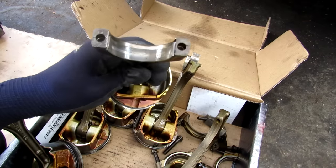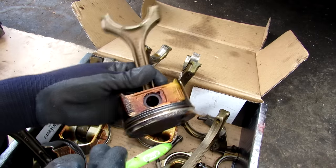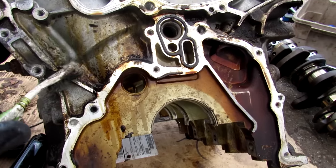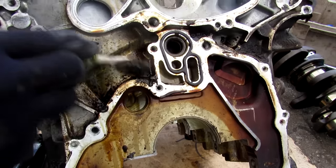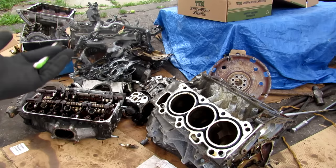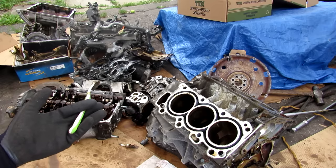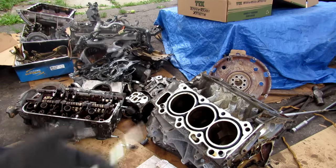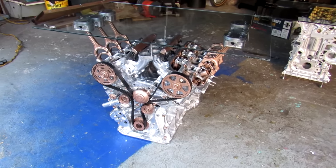Most of the other pistons showed only minor wear on the bearings — nothing like a spun rod or anything. The piston tops did have some carbon build up but overall this engine looked pretty mechanically healthy. While I don't see any major failure, I can definitely tell it's lived a long mileage or a really hard life — probably because it's inside of a Type S and people really pound those cars. You can see there's so much sludge build up inside, so this definitely needed to be maintained a little bit better. So the next time you start up your old reliable Honda V6 engine, think of all the components that go into it that have been tested over the past two decades. Make sure you follow me on Instagram for more behind the scenes footage, and subscribe and hit the bell notification icon to see more videos like this one. Check out my new glass top coffee engine table I made out of the Type S engine — it's even got a working flywheel clock on the back.